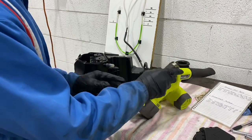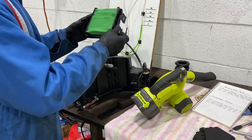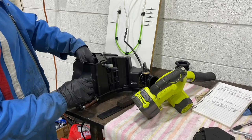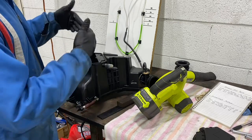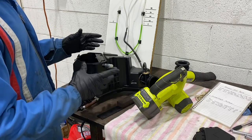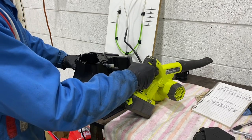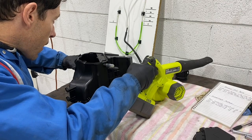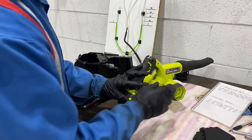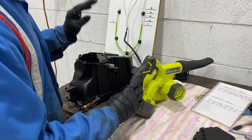So now we're gonna go back, we're gonna take the air filter out. Brand new. Now what we're testing now is the restriction on this long intake runner. We've got a door open here, we've got a smaller opening here and a larger exit here. So I'm tipping we're gonna get a restriction with this as well. So we'll have a look, low speed. So that's about 18, so it's just under 20. So straight away we have less of a restriction without the air filter in, but there still is a restriction there.